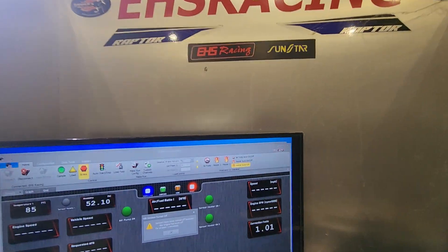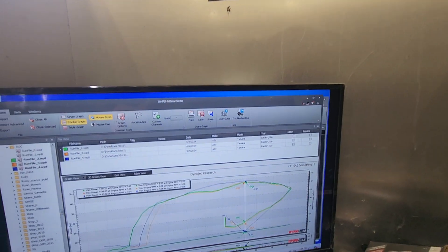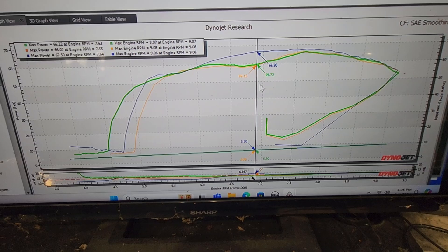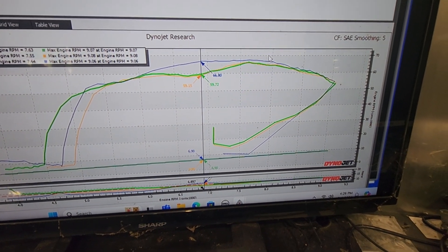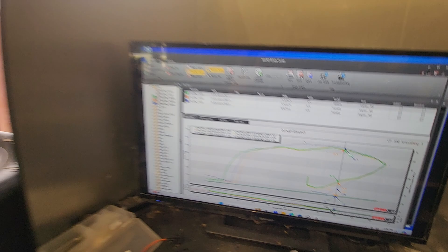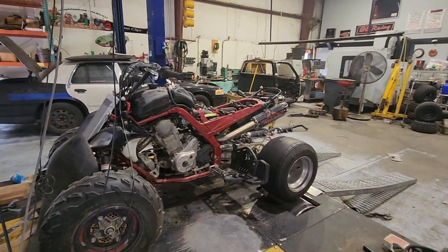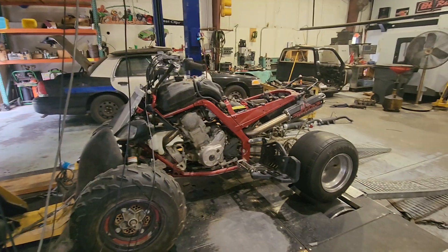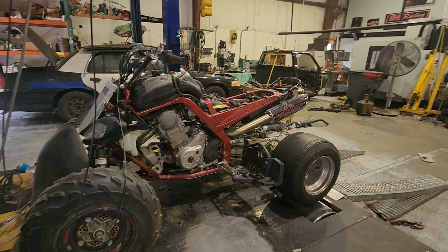All right, first pass results right here — blue line. We picked up seven horsepower. More in the over-rev. I'm going to do a pass and show you, and then we're going to come back and put some MR12 in it. Then I'll make some quick adjustments only on the fuel controller. That's why this is so cool — when you match a flash with a fuel controller, you can adjust for easy things like fuel or a throttle body change where the parameters aren't way different and you don't have to send the ECU back in.